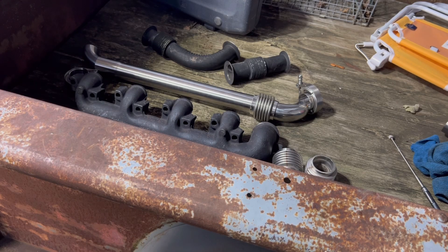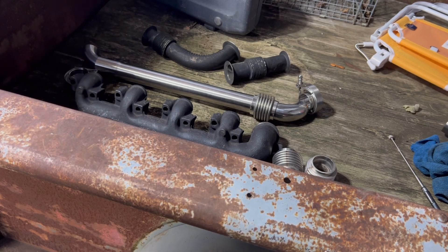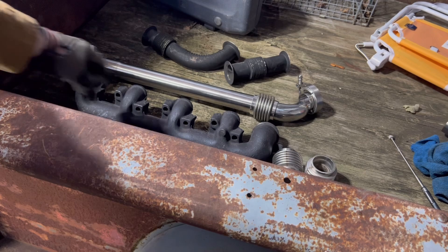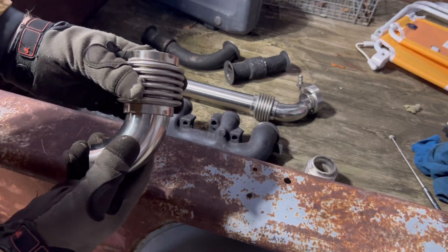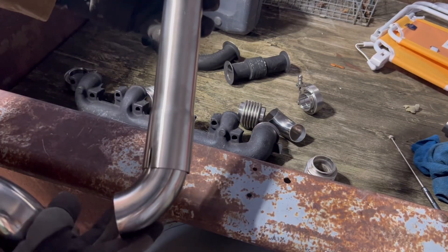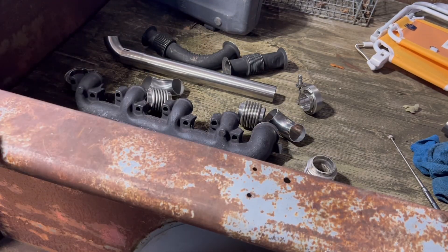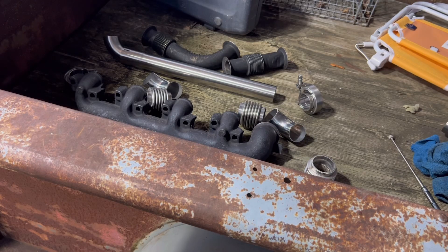I'm going to try to get my scrap engine down here sometime next weekend and make it fit in the little shop of horrors here. That way we can start bolting manifolds on, mark them, cut them, get those V-bands tacked while it's on. We'll make sure that everything comes around the back of the heads and points where it should. Because if I can't get this to clear the head the way I want it to, then I'll have to go to inch and a half pipe. So we're going to leave our Legos lay here for a few and run out to make sure inch and three quarter actually fits between the head and the firewall on Casper. And if it does, then we'll just keep on plugging away.